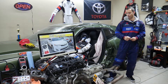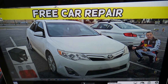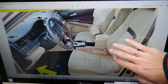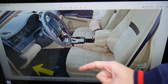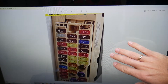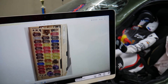Now let's explain where the windshield washer pump fuse is located. We'll demonstrate on a 2013 Toyota Camry. You have two different fuse boxes — we'll be working with one of them. The not-so-convenient news is that this fuse box is right under the dash on the driver's side. Look above the pedals on the left side, all the way under the dash — you'll see a white cover. Once you open that white cover, you'll see a fuse box layout that looks just like this one.